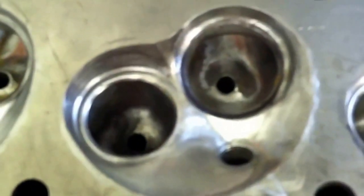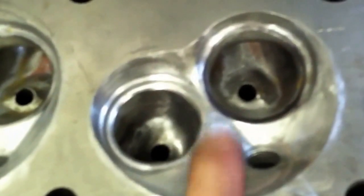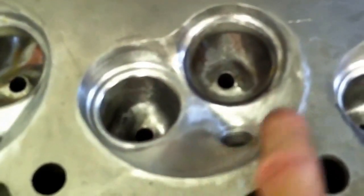So that's it — that's combustion chamber polishing, what it should look like: baby smooth. And that's accomplished with just a stone, followed by coarse and then fine sanding rolls, and just patience. Over here we've gotten the first round of experiments as to what will happen if I try to unshroud the valves. I strongly recommend that if you're going to do any of this work, you get a junk head that's cracked. This one has been identified by the machine shop as garbage, so I don't really care what happens here.